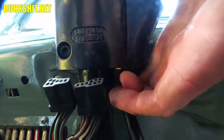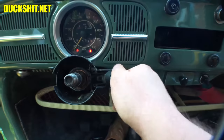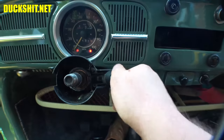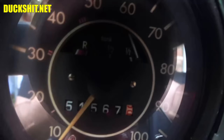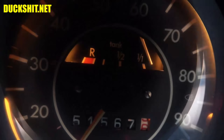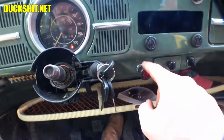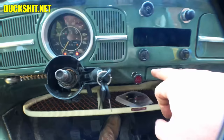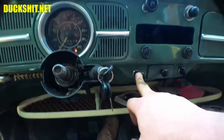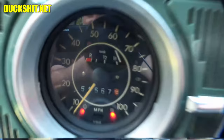Let's reconnect the battery real quick and just verify things switch on like they're supposed to. If we have a bigger problem, we want to know it now. Yeah, it looks like it's working okay. The start is currently disabled because the start button is up top instead. Should we switch on headlights? We should have lights now. Hey, we do. Good. Whereas before we did not. If I pull this on — there you go. That's something that was not working properly before. What about the four-ways? No, they're not working. When the car first came home it did work, and then they never worked again. I'm going to have to look at that — that's a separate circuit. So far, so good. Headlights are working again and they're reliable, which is something they weren't before.